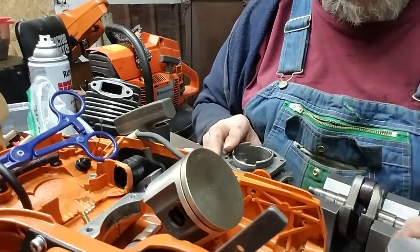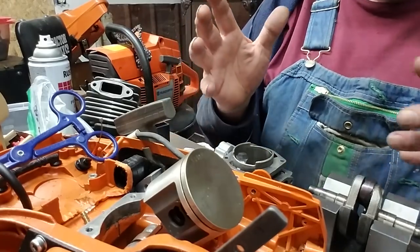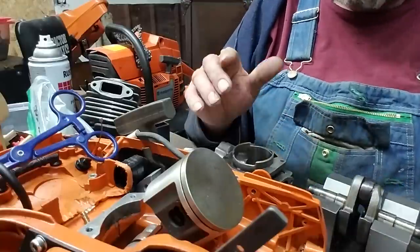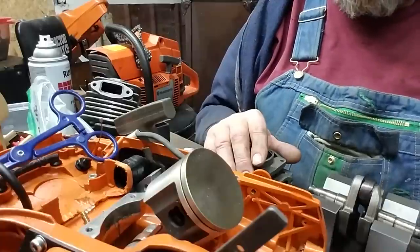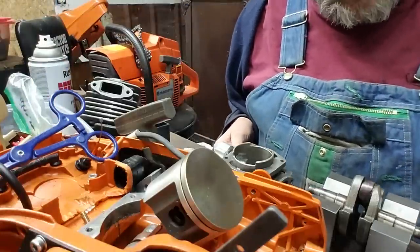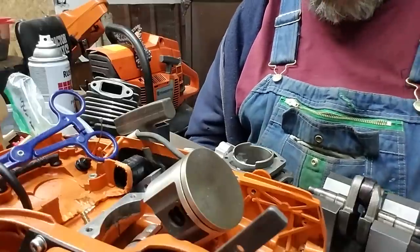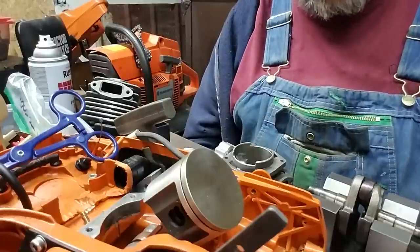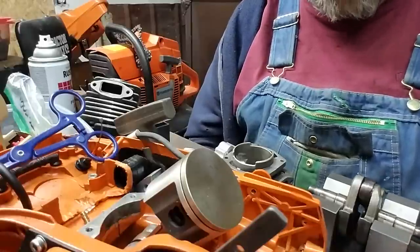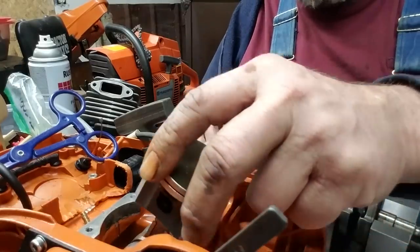With an angled plug versus a straight plug, that whole thing changes. I'm not going to give exact numbers on what I'm doing here because we're not sure exactly what we want to accomplish. We know it's going to be a high-RPM build. It takes a lot to make one of these live — we're going to be putting a lot of pressure on the bearings, so we are going to use ceramic hybrid bearings. You'll get gains out of that, but I'm very worried about bearing failure even with that if we start pushing major horsepower.